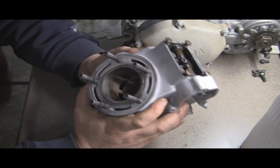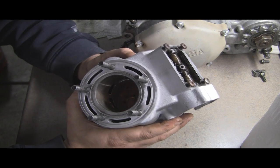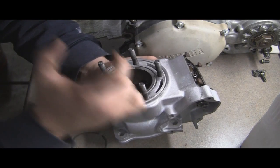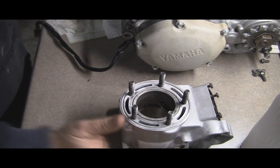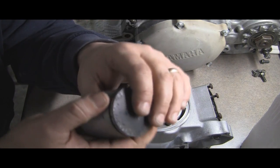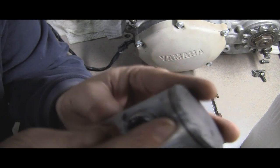I'm just going to open up that port just a tiny little bit. I mean, we're talking maybe a millimeter. They're really small, but those little nicks are enough for that piston ring to catch in there. So obviously the guy that had it before, here's the old piston. It's all chewed up. There was something, whether it be in the motor, which I've already taken apart, cleaned, with new bearings. You've watched those videos. Here's the side. Look at that gouge.